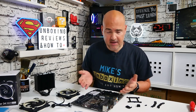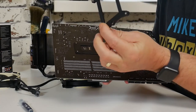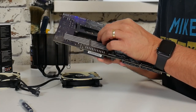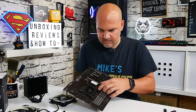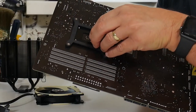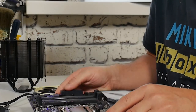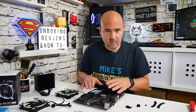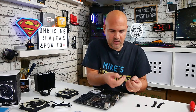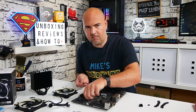First, let's start with the base. Flip over the motherboard and give it a good clean if there's any dirt or debris — if it's a new board you don't need to do that. Looking at the bracket, you've got the Arctic logo printed on top and the extra hole on the bottom. Line it up and make sure all the pins are pushed in firmly into the board, and from the side angle it should be looking flush. When you flip it onto a hard surface it should level itself out, and from the top you should see all the threads sticking through.